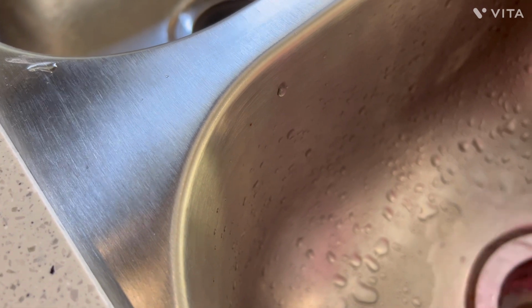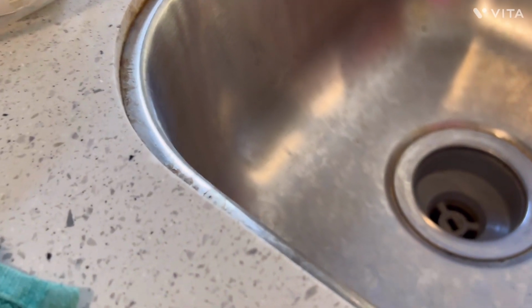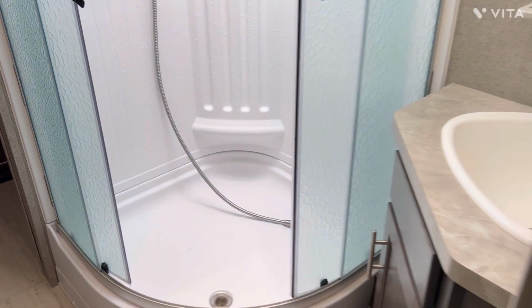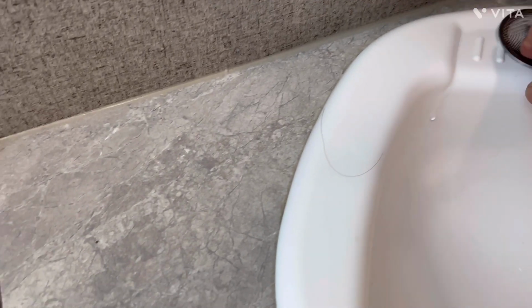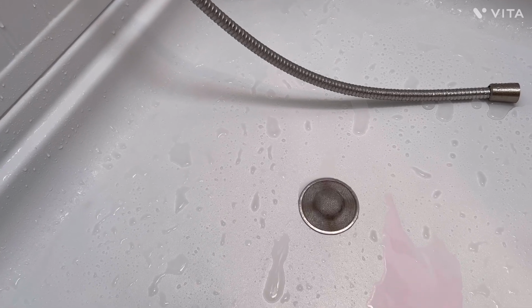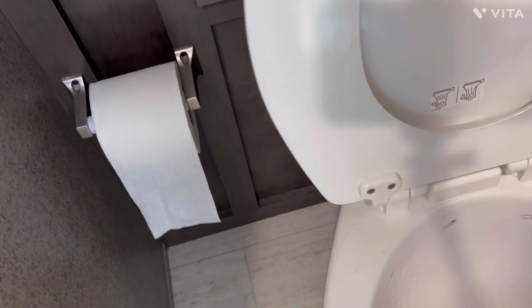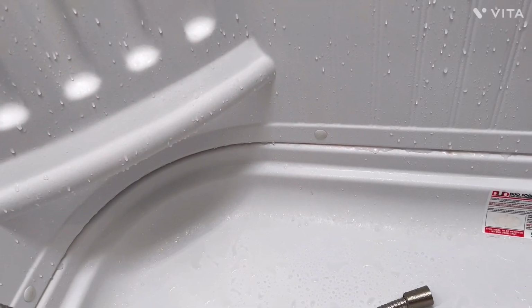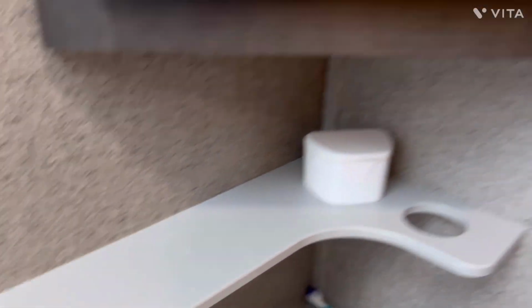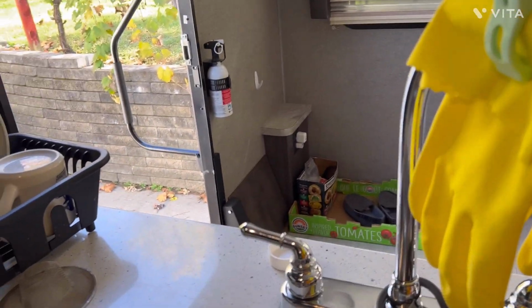So I'm going to add in every one of the drains some of the RV antifreeze, and this will protect the drains and the tank a little bit. I mean, I've emptied my tanks, but the drains, I guess I could figure out a way. Let's put some in the black tank. Let's put a little bit more down, because that does run into the gray tank. And I want to make sure that this gets through the traps.